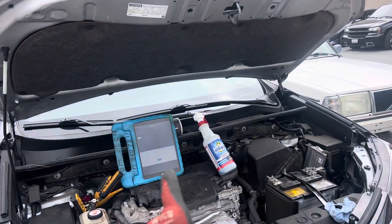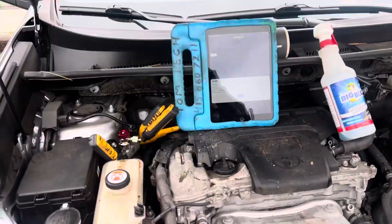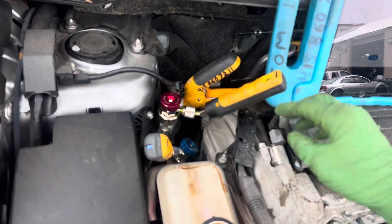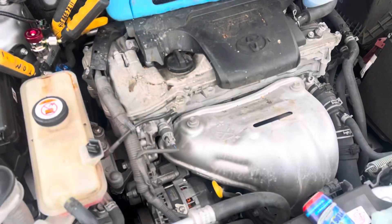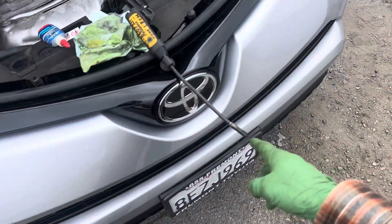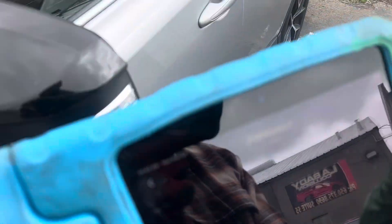This is Video 2 on the air conditioning system of a 2018 Toyota RAV4 with R134 refrigerant, 500 grams of refrigerant. We're all probed up — we've got our pressure transducers, clamp-on thermistors on the pipes, the suction and the liquid line, our ambient temperature and humidity sensor, and others on the inside. Let's see what we have on this running operation-wise.